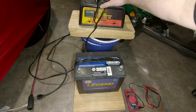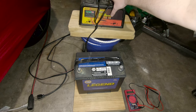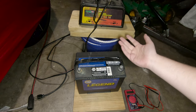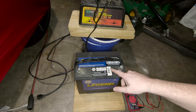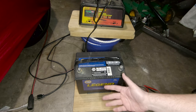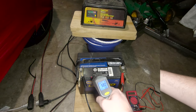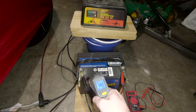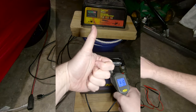So I had to break out this crusty trusty battery charger that doesn't have such nonsense in it. Now low voltage protection is actually a really good thing because it can be very dangerous to charge a battery that has developed an internal short or the cells have reversed. So when I first started charging this thing I monitored it with an infrared thermometer, and when I was satisfied that it wasn't going to burn the house down I went ahead and let it charge overnight.